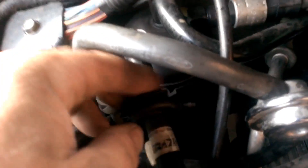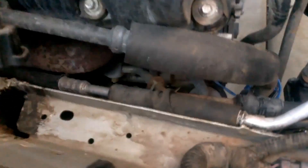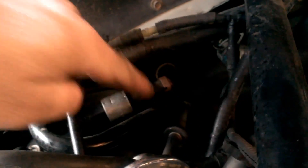I need two hands again. Basically you just get that in there — goes underneath the spring — there we go, and it just pops off. And then the other connection down on the compressor — I don't think I'm going to mess with that way down in there for right now. I was getting pretty good beeping out of that fitting right there. That's the inlet to the accumulator coming out of the evaporator, so I'm going to have to unbolt the accumulator bolt to loosen the accumulator so I can get that line to move.